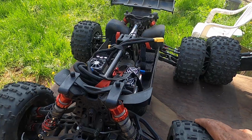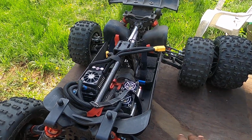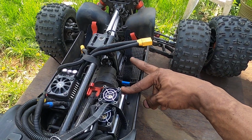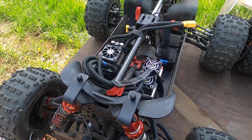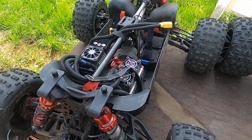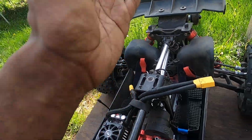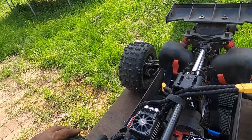But yeah, it does sound like BS saying that the 8S Outcast is actually harder to drive in the air than the EXB Kraton, mainly because of that equidistant drivetrain. Boy, that actually threw me for a loop when I first realized that. It really did, but it makes so much damn sense because of the dog bones being equidistant, that it would send equal power to the front and rear wheels. And that's when, yeah, it definitely makes sense.